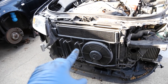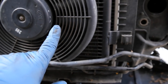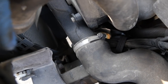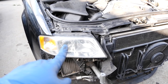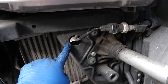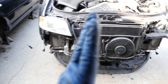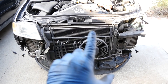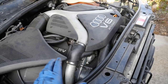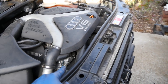But if you want, you can also remove these power steering lines, that fan, this ambient temperature sensor — and then you would need to fish this sensor along the wire for this fan down through here, then come down and there's a wiring harness down there that you want to detach it from and then fish it through this lock carrier towards the engine. Then you would also need to remove this headlight — two screws up top and one screw on the bottom. The sensor also needs to be removed and fished through that hole. And then from there, you can get this lock carrier out, detach it from that end, and then simply swing this side, giving you all sorts of access to your timing belt cover and your timing components. And this way, unlike what the factory says, you do not need to discharge your AC system and remove these AC lines.